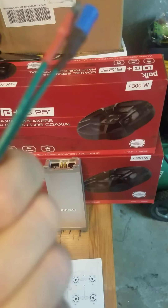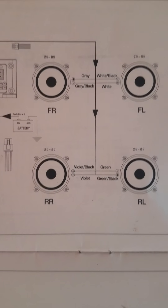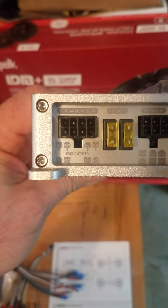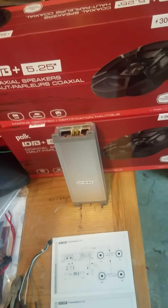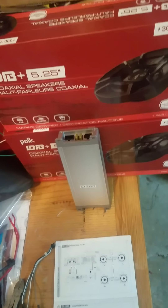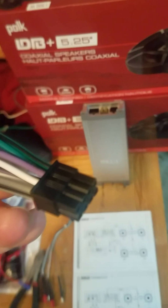So I'm going to give you an example right now. You look at this wiring harness that comes with this — this is the output side. It's hard to tell with my phone, but the top left is negative and the bottom left is positive. So keep that in mind — this is facing the direction where you'd plug it in. You can see the clip is on the bottom; that plugs right in there.